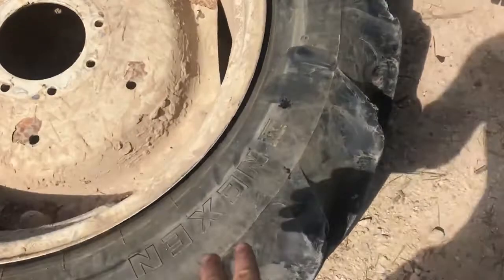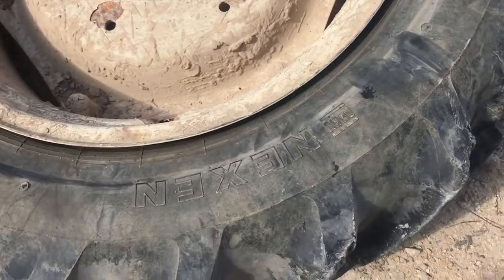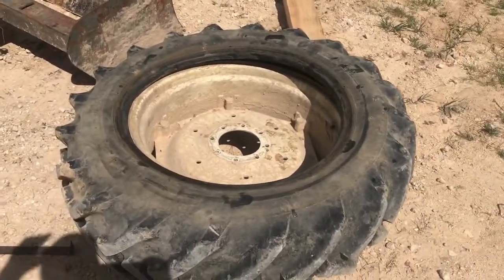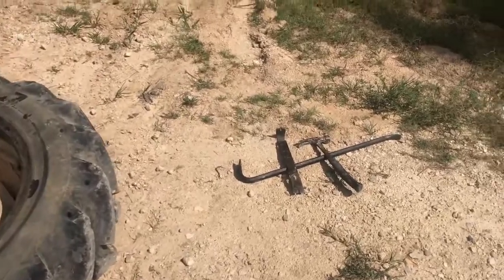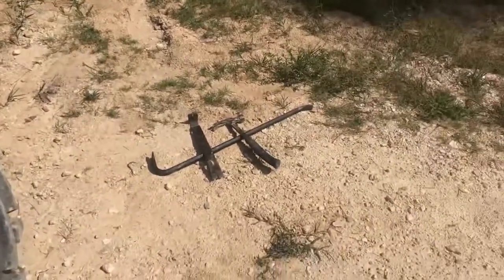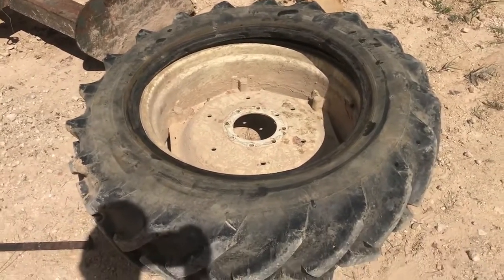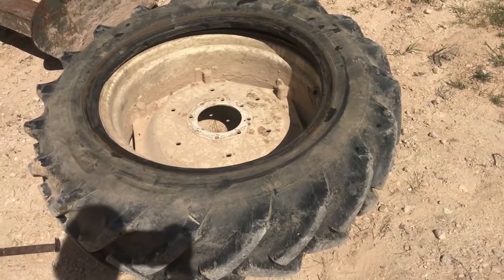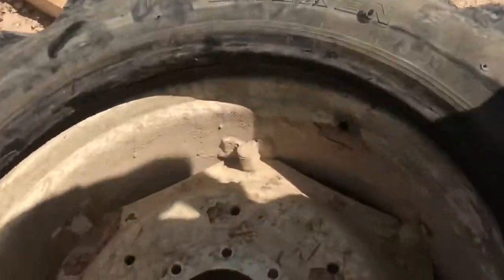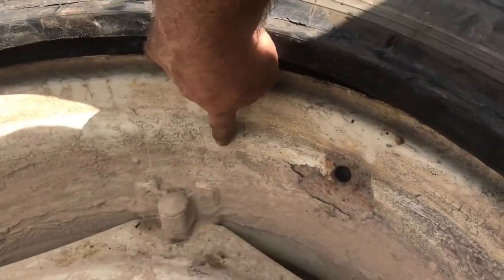I've got a couple of pry bars and flat bars, and we're going to give it a shot and see if we can pull it off. It is going to be tougher than a car tire — it's bigger, thicker rubber. Using the crowbar works best. I started with the flat end, got it underneath, got the first lip up, then used a flat bar to hold that, and went around about another foot around the rim. Once I did that about two or three times it actually got easier — the more play you get over the edge of the rim, the easier it gets.